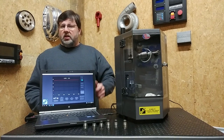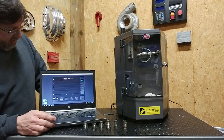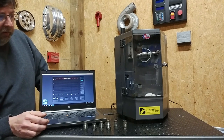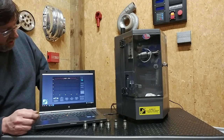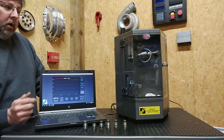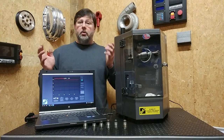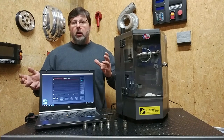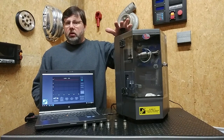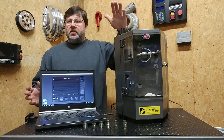We're going to run this thing one more time so you can see what this thing does and how it works. You saw it before — how once the pressure spiked up, it's just dumping. There we go. Look, it's holding it right there. It's a little over 200. This is a low output machine. And when we stop it — look — 92. Comes right back to the same place and it holds it. Guys, wise up. Motorsport Diesel: we have the knowledge, we have the tools, we have the equipment, we have the background, we have the experience to take your business to the next level. Quit messing around and doing stuff that you shouldn't be doing. Help your customers. Educate your customers. Stop guessing. Start testing.